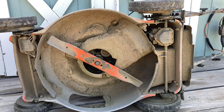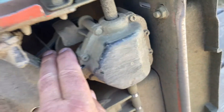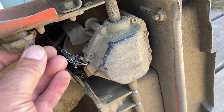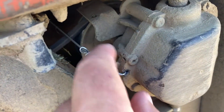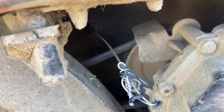I had to resort to Yankee ingenuity. I've got the lawnmower turned on its side and this right here is the gearbox for the self-propelled drive. There was some kind of plastic mechanism that the rock shattered. There's a cable coming down right here that hooked into that mechanism and pulled the gearbox up. There are these belts back here — when the drive is pushed back, the gears engage with the belt drive around the drive shaft.